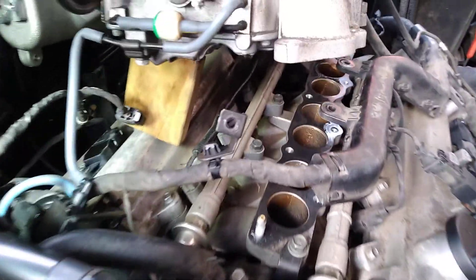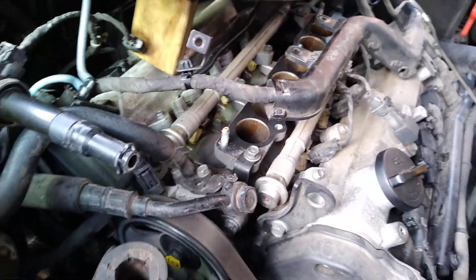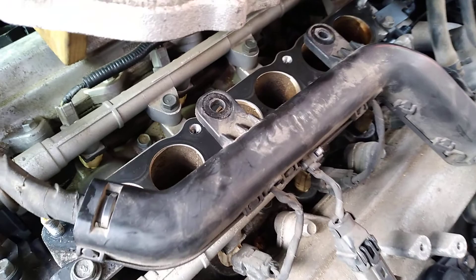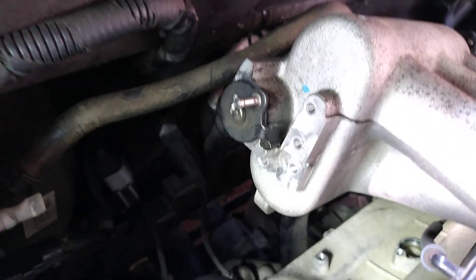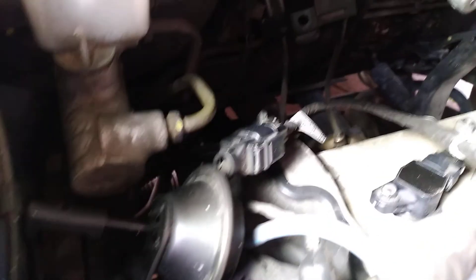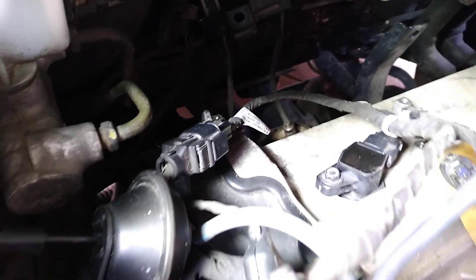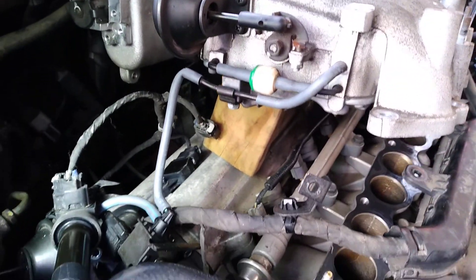So they'll all be new — this is number five here. It's not too bad a job, just take your time. I've got a block of wood holding the plenum up in place so I don't have to disconnect too many things. I disconnected the bare minimum: these two 10 mil nuts to move the wiring harness aside, the little vacuum unit — a couple of 10 mils — and the 12 mil bolt there that holds a little bracket with some plugs. It wasn't letting me get enough height. Plus you've got to take the 12 mil off at the back on that strap there.